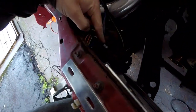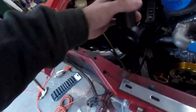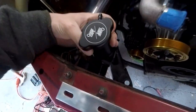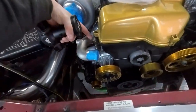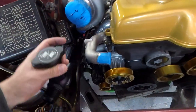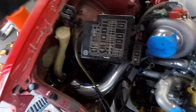You can see the intake is right here. I do have this fill port right here, which goes right in here like this. Once this is in, it makes it the highest point to fill the radiator. What I'm going to have to do is chop this off, chop this off, and aluminum weld this to this area so it can be the most direct route to the radiator.